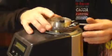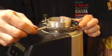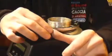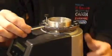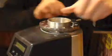Now the flange, remember, you've got it now in this case. Before you start tightening the flange, you want to make sure that the threads align together. To be sure to have that, turn the flange clockwise, where it says towards the grosso, which is actually to unscrew the flange. Just to make sure that it sits flat. Here it's bumping at a certain point. That's because that's the beginning thread, so you're just going over it. So just let it bump. That way, here we are, just over the starting thread, and then push it towards fine. Maybe put a little pressure on 2 opposite ends, so that the flange can sit even, and just turn towards fine. Here we are. So we're turning counterclockwise. This is the opposite of what you usually use to screw something in.